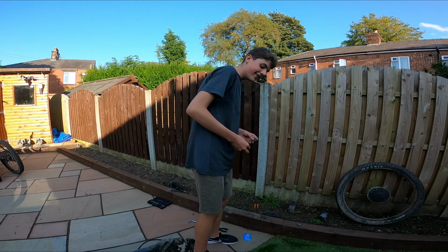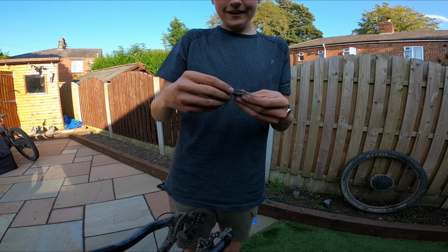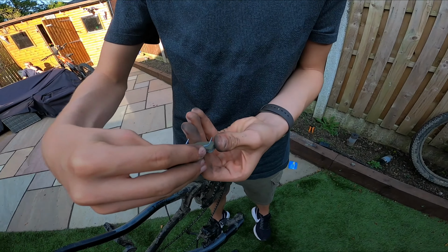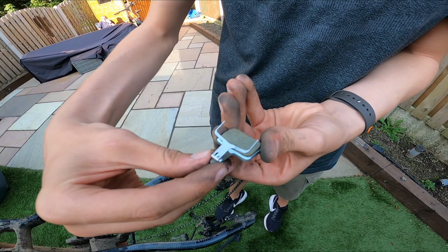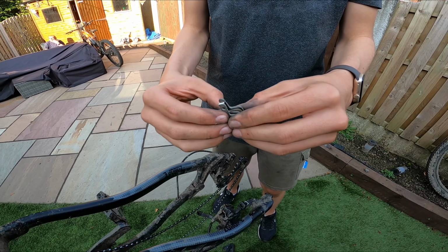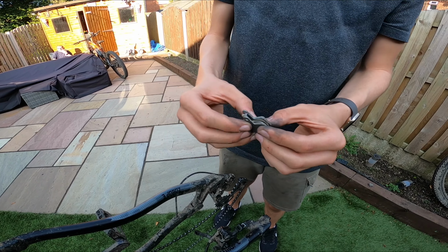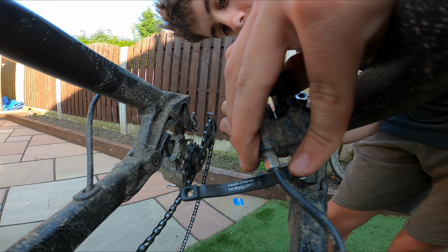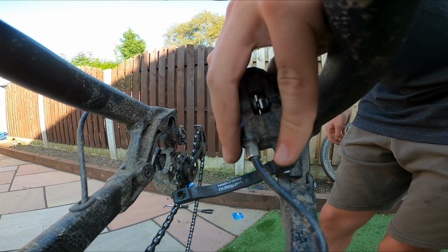So at the beginning, I usually thought that went there. No, it does not. It goes in here, like that. And then you get the other one and you do the same. So that's how you do it. That's a spring, so it retracts. They're usually fiddly to get back in, and this is why we push the pistons back, because if we didn't, they would have been a bit fiddly. But usually, they go in pretty easy.